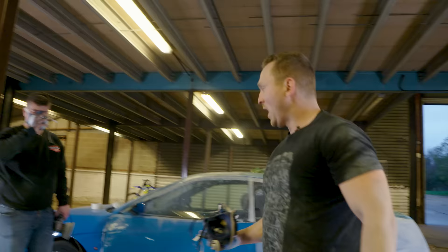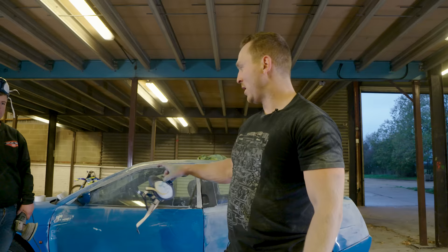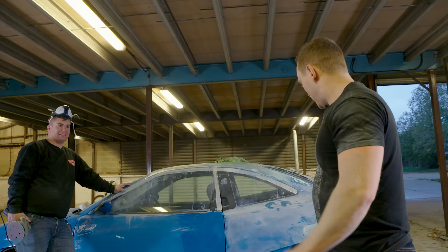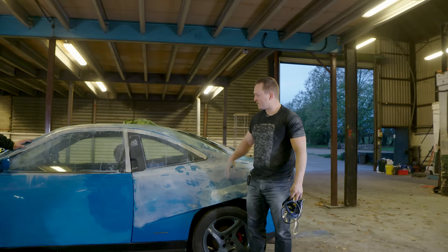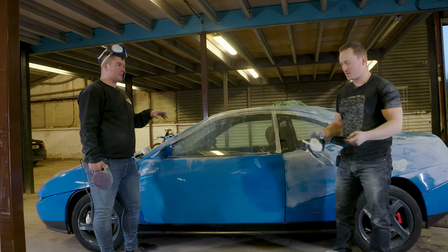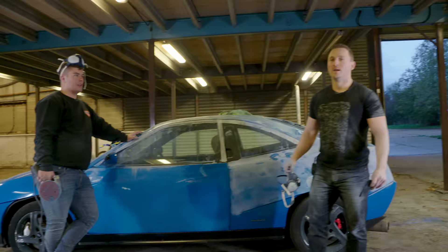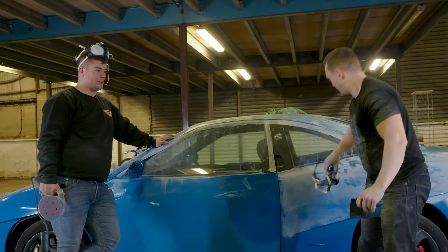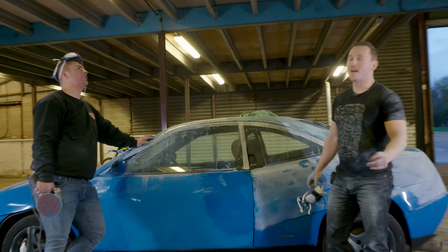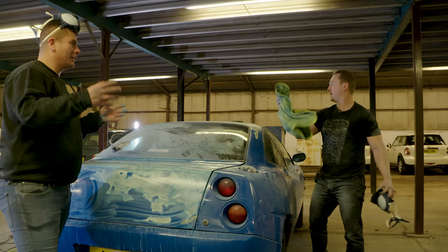You've got ADHD. I think we've made very good progress. The sander you brought was just too abrasive, so we're now using the orbital only and wet sanding. The aim now is just to flat it all off — that gives the paint a really nice key for the primer. What grade sandpaper are you using? This is 240 now. Do we have to go over it again with something finer? No, 240 and then it's primer. That's not how it works — it should be 800 and then high build primer, and then you wet sand the primer with 1200. I would just like to say when I've been to my body shop in the past, cars being prepared don't usually look like that.